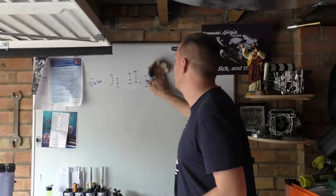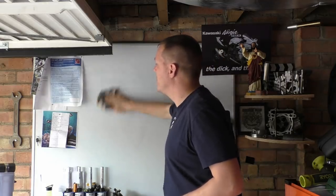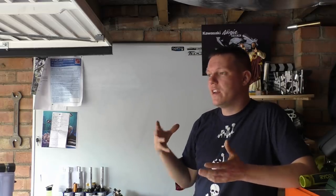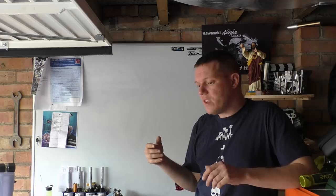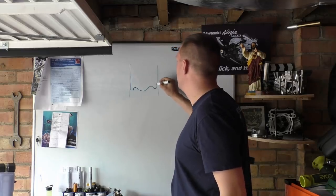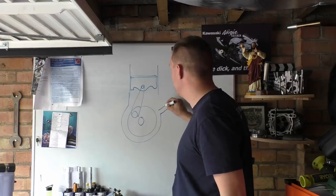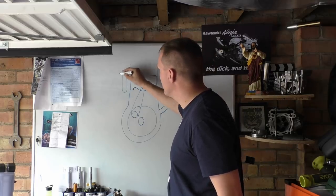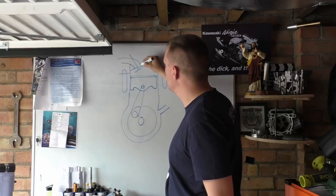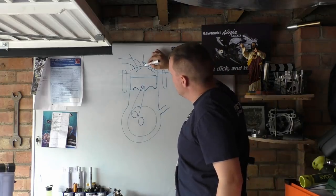The better test is a leak-down test — especially for two-strokes. Not only does a leak-down test give you a percentage of leakage, it's actually giving you more information than just the peak pressure. If you do it properly and set it up properly, you can actually diagnose where the problem is. With a compression test — for those who don't know — you have your piston in your cylinder with your rings, your crankcase with your crank, and then a water jacket that might be split because of a head gasket. You also have valves with ports.